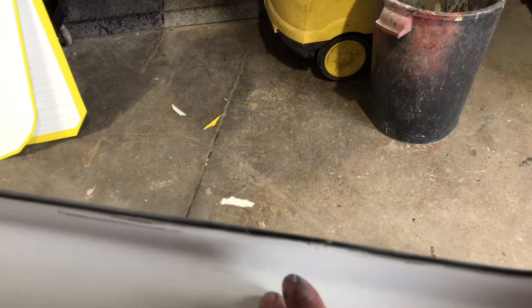Once the unwanted panel has been cut out, you can see it's double skinned. Between the skins there is some sealant. The sealant needs to be removed, because the double skin needs to be pinched together.